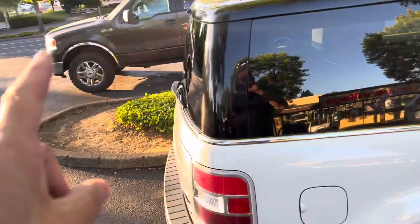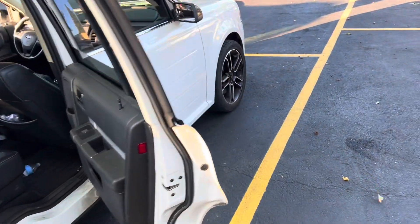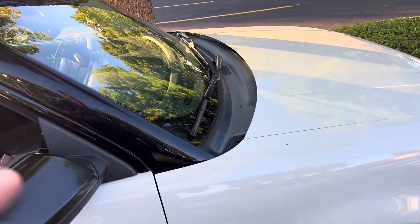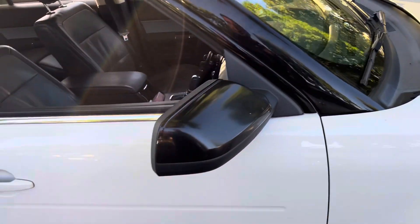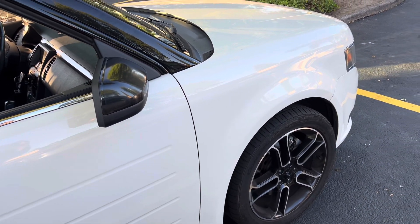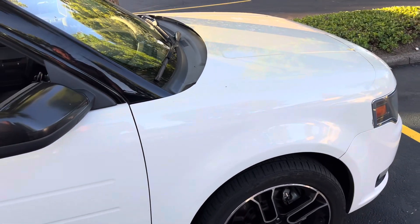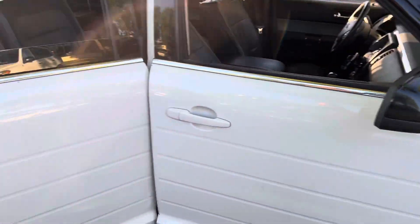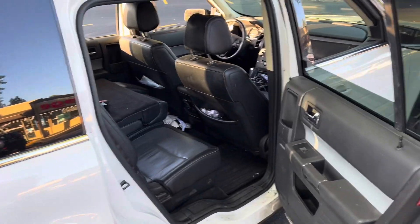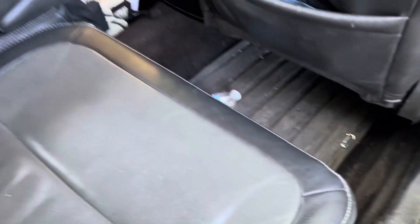So there's my truck. We also have a 2014 Ford Flex. If your Ford Flex is trying to start and trying to start but it won't start — it sounds like it's got plenty of electricity to turn the engine over but it won't start — it's a fuel problem. That's pretty basic, but this other guy on YouTube pointed it out. It's a $69 part. What it is, is the fuel relay.